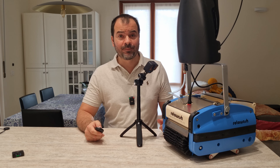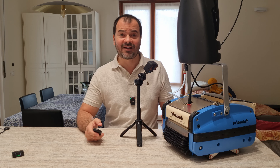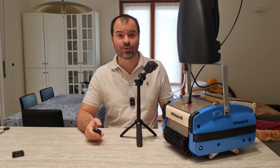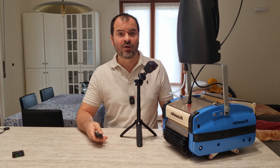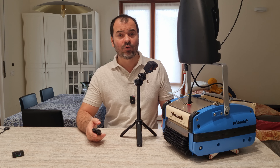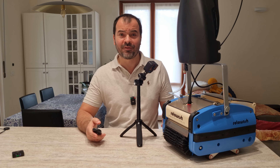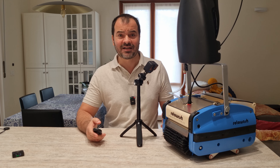And here you can see the difference from the dirty water of the first pass. There are numerous floor washing machines on the market, but if you think about it, 90% of them require a vacuum to recover the water from the floor, and some even need a pump to spray the water on the surface. When washing a floor, the variables to consider are brushing power, water quantity, and the machine's ability to self-clean while sending all the dirt to the dirty water tank. Most floor washing machines struggle with dirt because they accumulate grime on their cleaning parts, like brushes and vibrating mops.